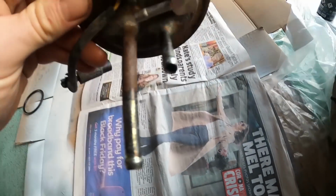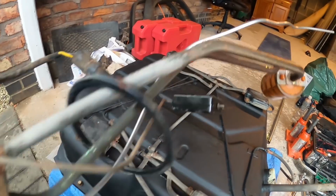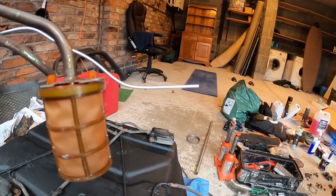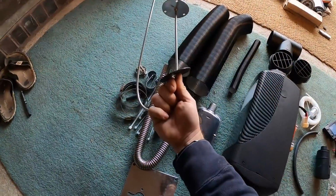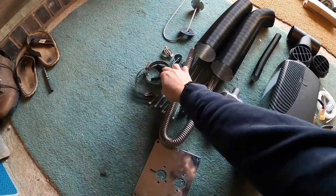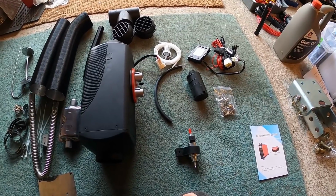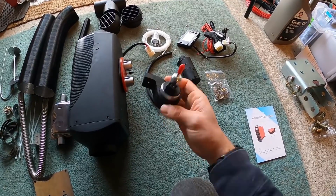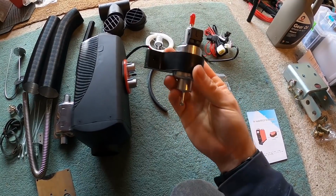Okay, so I have drilled a hole in the sender cap for the diesel heater, the new diesel heater section there, which is that pipe that runs down to the end. Kept it ever so slightly higher than the bottom of the pickup, so it will never run the tank completely out of diesel. So you can see that, and all the associated clips and fuel pipe and things, little filter to install the actual thing itself, and the pump, the fuel pump. And that's got a little bracket, which is, because these click a lot, the rubber I suppose helps deaden the sound.